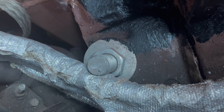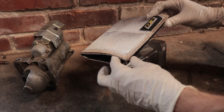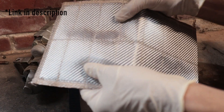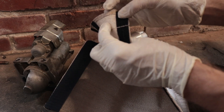Let's talk about the different kinds of heat wraps. From my experience, there are two basic categories. There's a fiberglass with an aluminum cover over it — that's the cheapest kind of heat insulation you can get. While it works pretty good at reflecting heat, especially with multiple layers, that aluminum foil layer likes to peel off over time and flake everywhere, leaving exposed fiberglass that slowly breaks down. To solve that problem, DEI makes something called the Ultra Shield. It's like a fiberglass material — flexible, strong, bendable — but it doesn't have a bonded outside layer of foil that peels off. It seems to be woven onto the fiber, kind of like a pseudo-Kevlar aluminum foil hybrid.